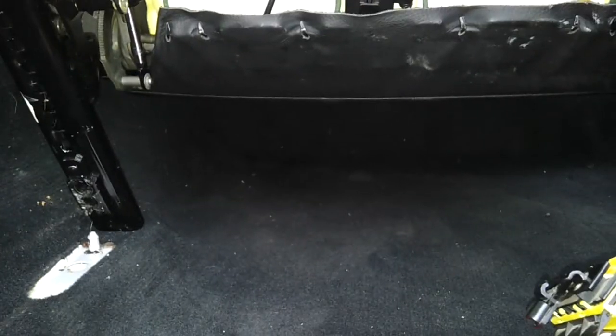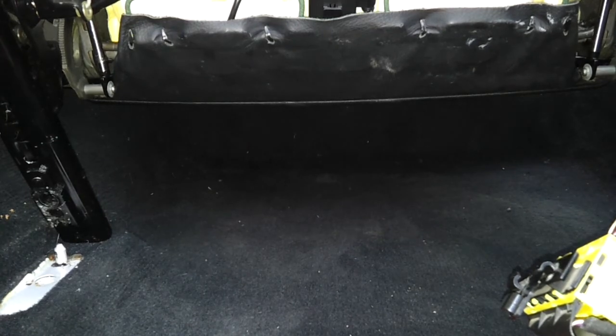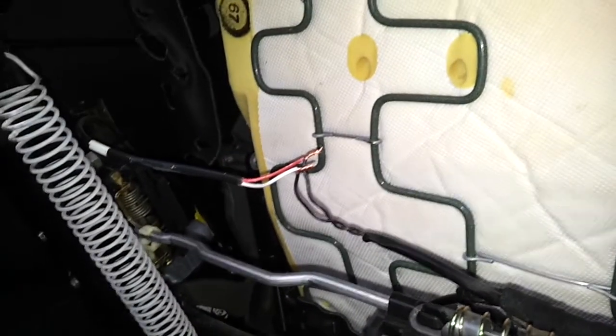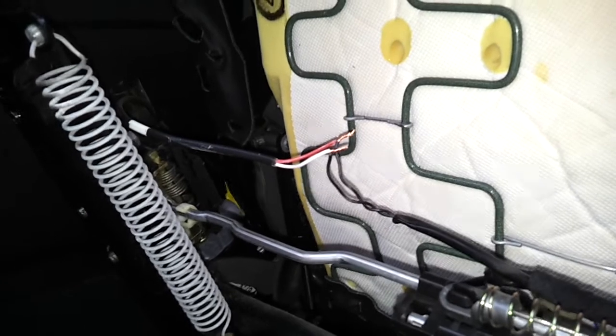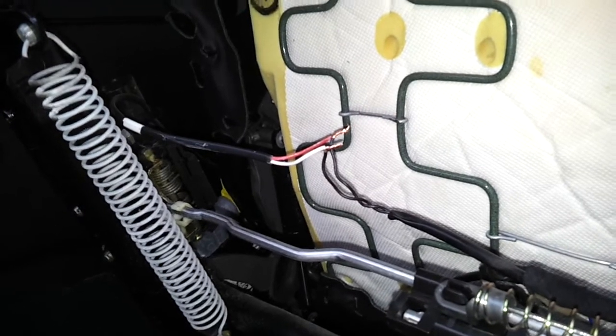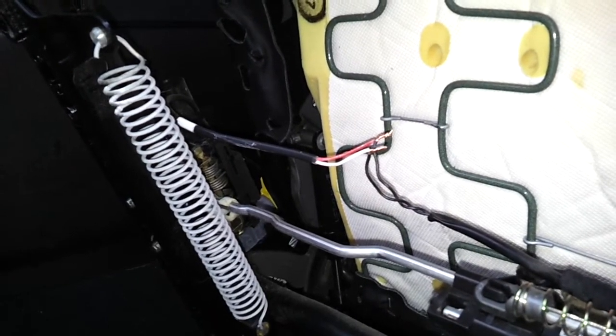Connected up the PC and it just told me that's fine — passenger seat sensor is good. The only problem was the seat belt tensioner, so I decided to just take a flyer on that and did a very quick mod: just chopped off the cable and joined up the yellow plug to the black plug cables. Plugged in the computer, cleared the codes — we're done. It looks as if in my case the two seat belt tensioner systems are in fact compatible, versus what was being said on some of the forums.